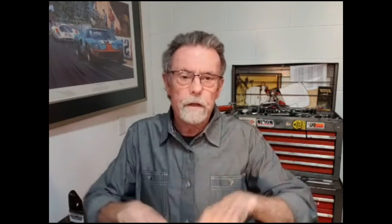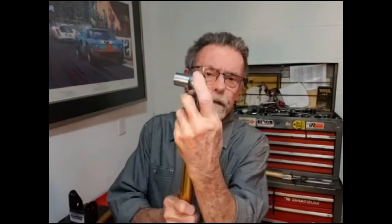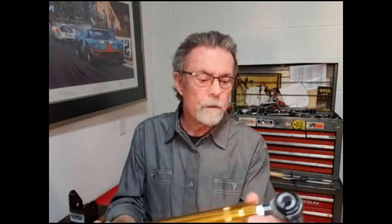By making the control arms parallel to the centerline — which is what every race car I've ever worked on does — there's no point of convergence, meaning the point of convergence is at infinity, and the roll axis becomes parallel to the control arm. Also, we put a rubber ring near the rod end so that just in case it wants to roll over at the chassis or at the axle end, that ring catches the rod end and prevents it from clanging and banging.